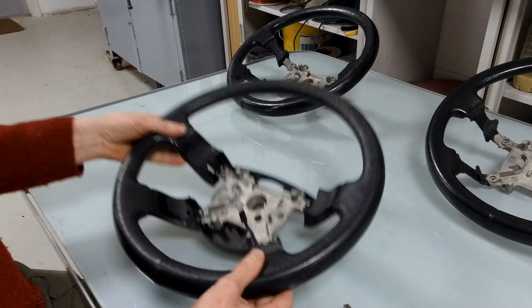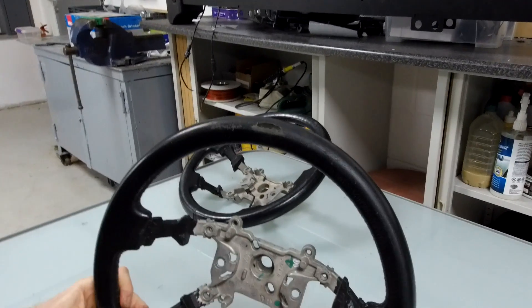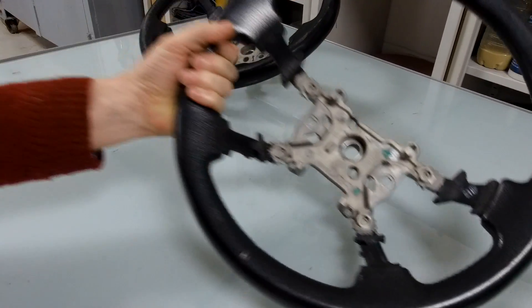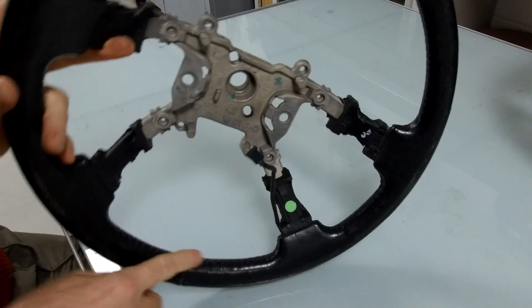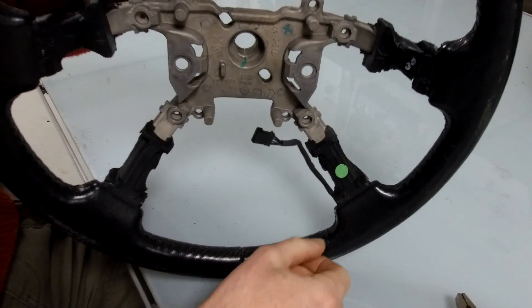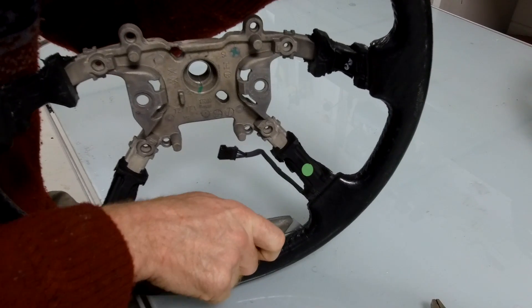So that's the Range Rover L322 steering wheel. I've got one here with the plastics taken off - let me just show you here. This one's with the plastics taken off. This is a non-heated, so you've got no wire coming out of it anywhere. And this is the one we're going to cut up today. We've got the wire coming out - it's heated here. You can tell a leather steering wheel because it's got stitches. Some plastic polyurethane steering wheels have what look like stitches but they're not real. So let's have a go at cutting all the stitches out.